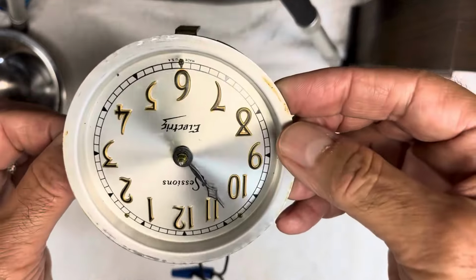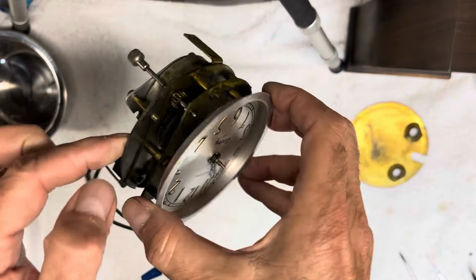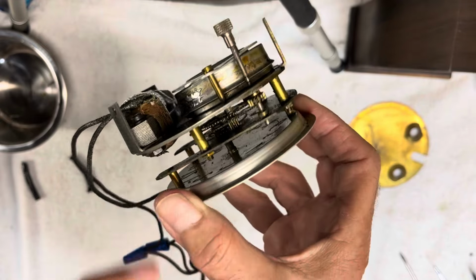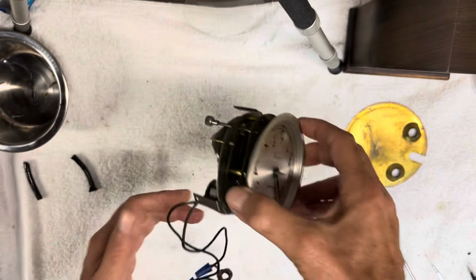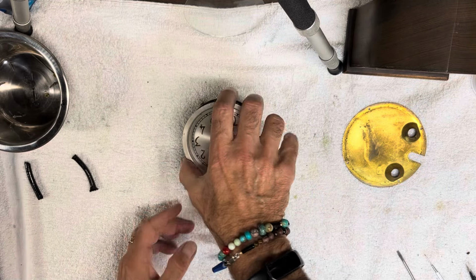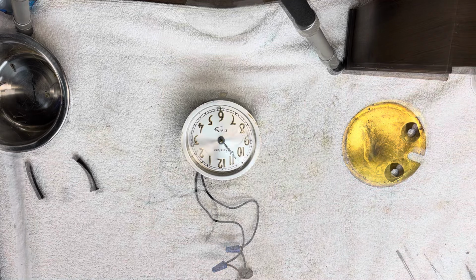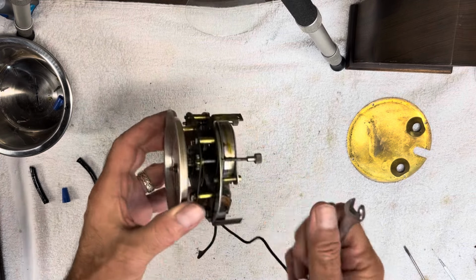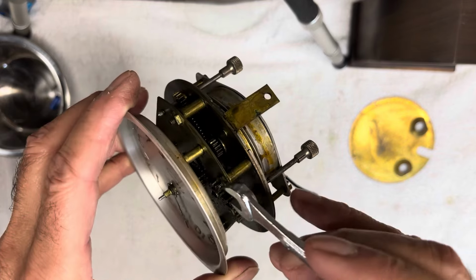but it's still making quite a lot of noise, which means I'm going to have to open it up, as I mentioned earlier, by undoing the nuts on the side here, all the way under there, that are positioned under the dial. So let me get set up to do that. Turn it off. What it looks like I can do is, with this small wrench, I can slip it in and undo the nuts that are in here.